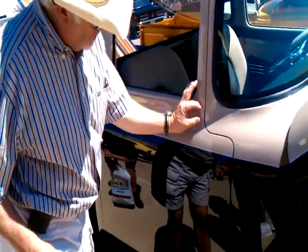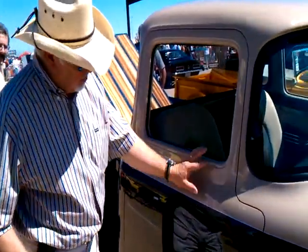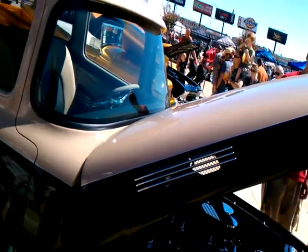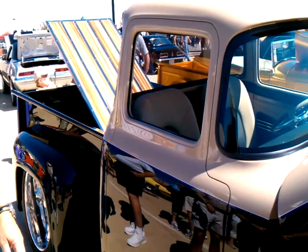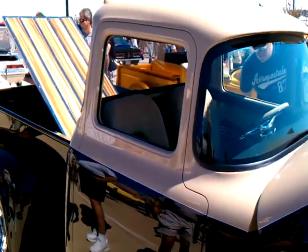There's a wedge taken out of the door from that wide to nothing back here. So usually this is much wider here. Then there's 2 inches taken out of the front of the hood and nothing here. So the whole thing just gets more rakish looking. Even though it's sitting rakish, the body's rakish too. And then the wheelbase has 4.5 inches. So the fender, well, moves forward.